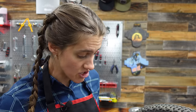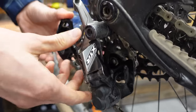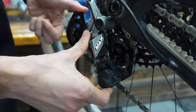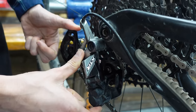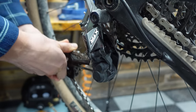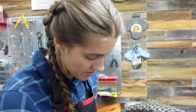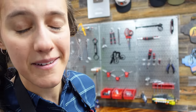The way you know if you need to service or adjust your clutch is if it's in the on position and you're still getting quite a bit of movement. This one does not really need to be adjusted — it seems tight enough. But if it were breaking through like this, it wouldn't be tight enough. See how it's kind of sticky as it breaks through — it has a couple of catch points, not just one, not a smooth rotation. This bike has quite a few miles on it, so it's definitely time.